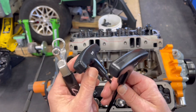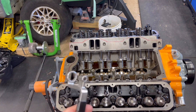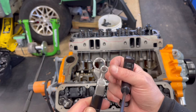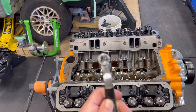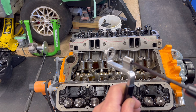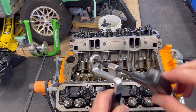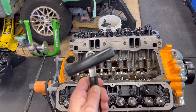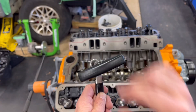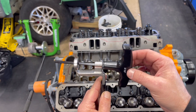This is actually a really cool setup. What I like about it — when you put this over your rocker arm stud nut and you're setting it, this wrench, or the T-handle, slides right in there. Direct shot to the center and you're able to lock it. You can have it in place while you're doing other things and lock it right in place. I really like this. Let's show you actually how to do this.